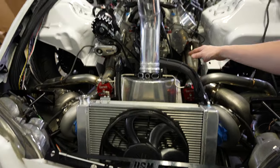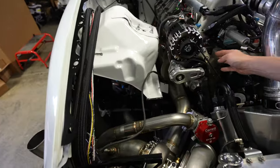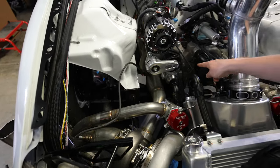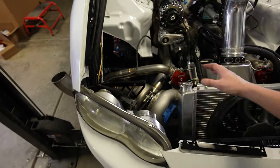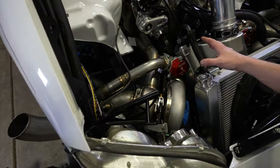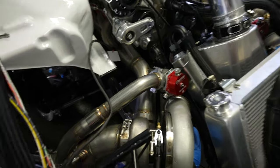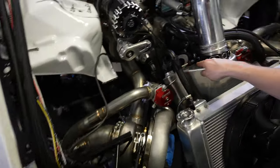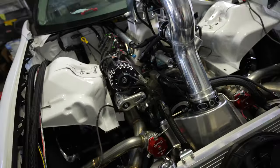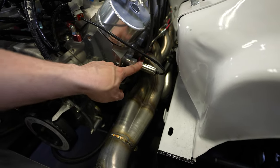Some of the things I've completed: all of the hoses for the cooling and fuel system, got everything ran. I still need to make a little mount for the regulator. Got the alternator on a belt — I think I need a slightly tighter belt, it's like 52 and a half inches, needs a specific size. Got all the turbo kit finished up and mounted fully. I built hard lines for the boost line, which is super nice and clean, and hard lines going down to the intake tube underneath the turbo for the bottom side of the wastegate.